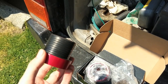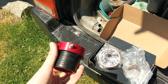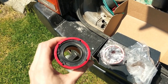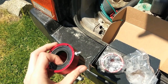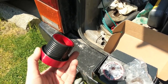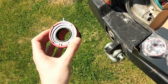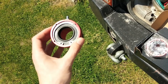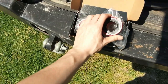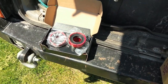For those that don't know, this is an outer axle tube seal. It's got a grease fitting. You slide this side into the axle tube, and this side points out towards the shaft, and then the grease seals it up. All this does is keep dirt, sand, and dust out of your tubes. This is not a critical component — it doesn't really matter if there's dirt in there — but for people that like to keep things clean, it's useful. We're going to slide them in while we have the shafts apart.